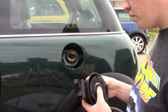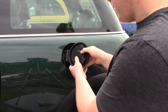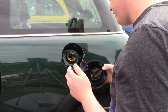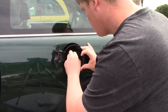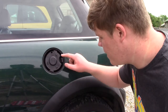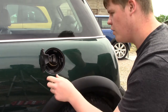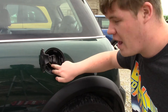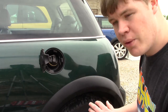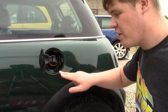The way you do this is close the whole unit first, and you want to tuck this long side here around to the left first. Now it is a little bit of a squeeze, so just bear that in mind going in. You may actually have to open it to get it in. Just open it and let that dangle down there. Managed to get the filler flap on here - works just like it should, looks perfectly normal on there. When I did this though, the filler neck in here that we took the screws out of, just behind here, I did have to wiggle it a little bit - just bring the filler neck down and then slot it in, and then just wiggle the filler flap through the little rubber seal here. It wasn't too bad to be honest - give it a go, see if you can do it.